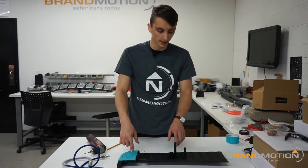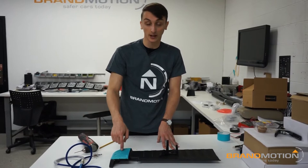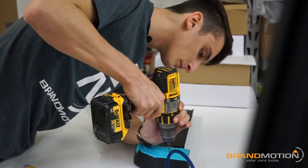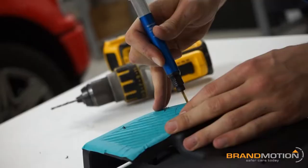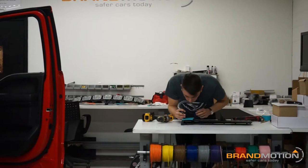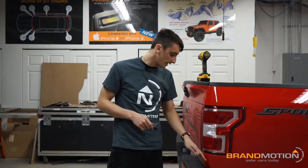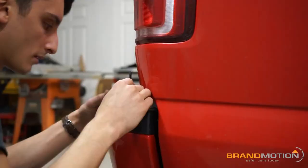I've used my base to sketch out the connector hole and mark the 1/8-inch drill bit locations. I'll finish up these drill holes, make them nice and clean, then use the Dremel tool to cut out the connector hole. Now that we've shown the modification process on the bench, we've got the actual bumper cover all modified — holes cut, holes drilled, and ready for mounting.